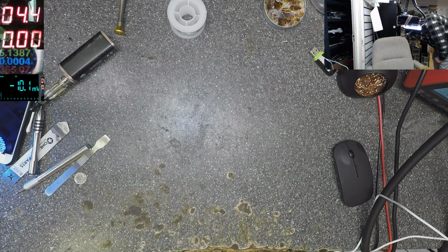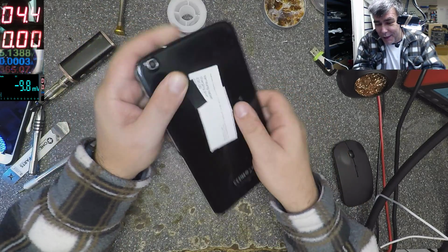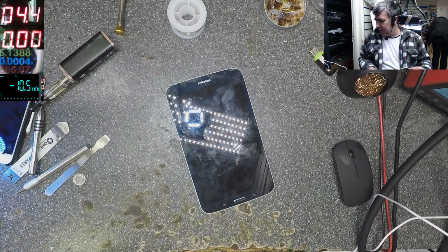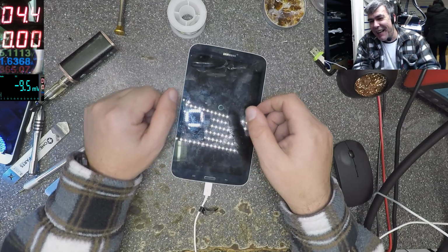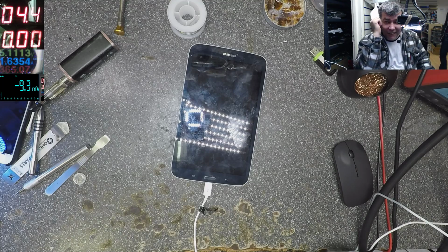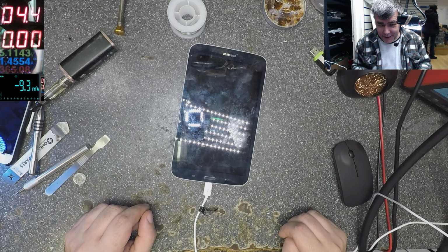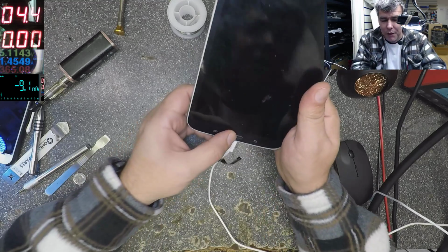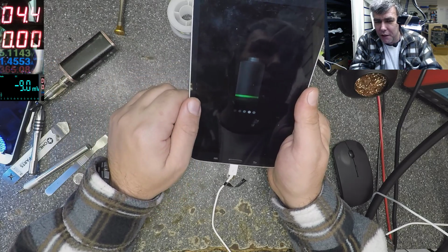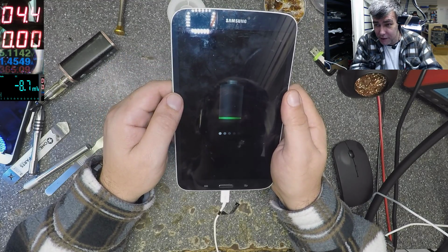Okay, next job. Hopefully this will not be the same disappointment. Charging board, Samsung again. And this charges at 1.6. I can't believe it. This is sick. This is real, this is a shop, I don't make up the jobs. Same story as the other tablet, so I will not repeat myself. It's charging fine, 1.4 amps, nearly 1.5. Everything is fine, no issue. But the tablet comes in as a faulty charging port. Same story.